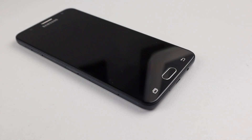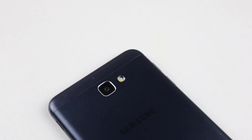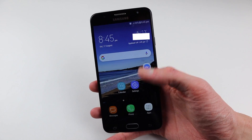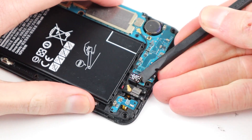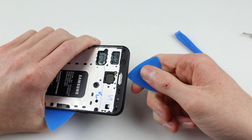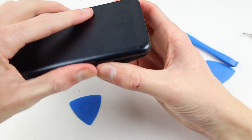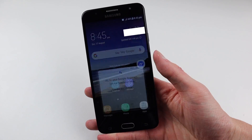A simple repair turned into something a little bit more difficult thanks to a phone that's not really designed to be repaired. The display was glued down, which made entry very difficult and made it very likely to damage something like the home button and back button cable. The battery is also very hard to replace given strong adhesive, the charging port is soldered to the board, and the back of the phone is held together with loads of plastic clips. Simply put, this phone was not designed to be repaired.